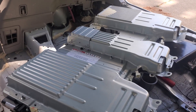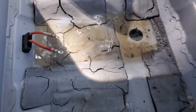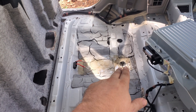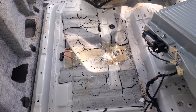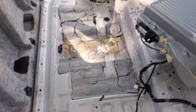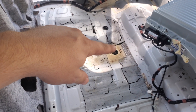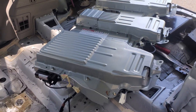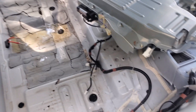That thing's a little heavy. There is the main drain — it's kind of a poor design, truthfully, because it scoops down and then sits back there, and there's only one drain. It's got a little filter in it which is easy to stop up with dirt. This vehicle has 270,000 miles on it. I'll go ahead and take this plug out, clean up the screen real good, and get all this cleaned up.